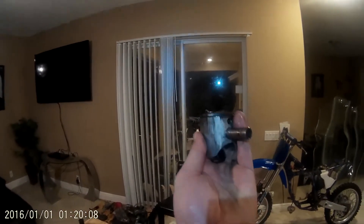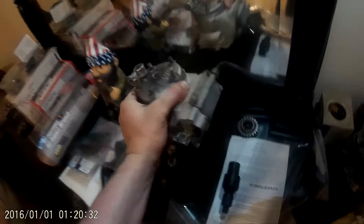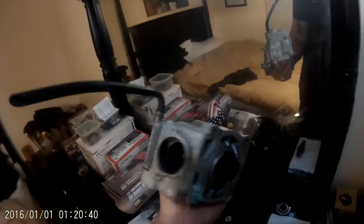You got to see this piston — see that piston? It seized to the cylinder. It's a bad piston. Got you a nice set of reeds. Boyesen reeds. There's the cylinder — 98 YZ 125, 54mm stock bore. Hone it real good, bring that cross hatch back. You're golden.